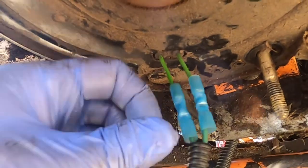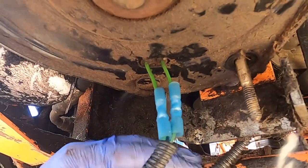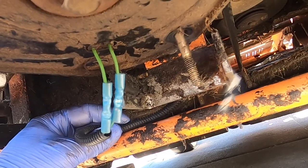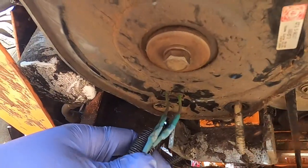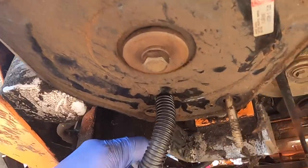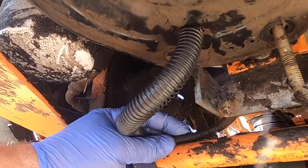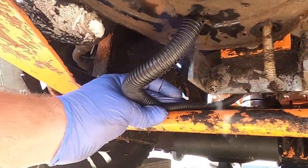All right, so we got the heat shrink tubing on, just have to put some heat to it. I like where this is at, and this is gonna come down. I'll probably put the half inch over top of that, and this will sit just like that. Let's get it buttoned up. So I've got the heat shrink all done. I've got the large wire loom over top of that. Double layer it. I'm gonna put some zip ties on there and then get this moved out of the way. I'm gonna allow a little bit of extra flex. Not that it'll need it, because this doesn't actually move from here, but just in case it does, there'll be some flex. So I'll get the zip ties on the back of this, so it doesn't move up and down, and then I'll throw one here.